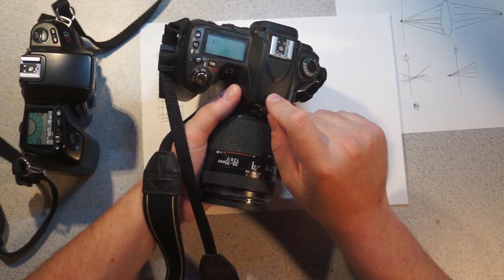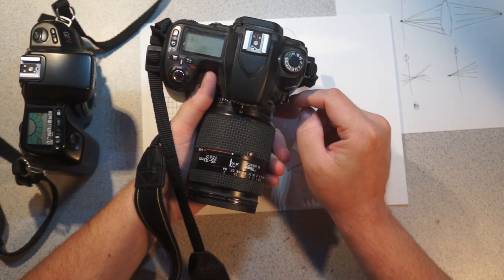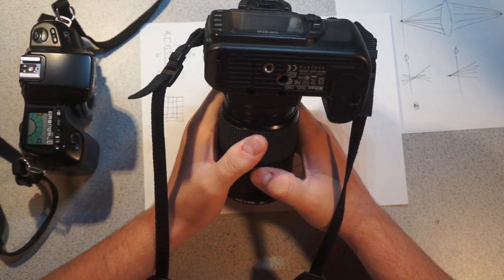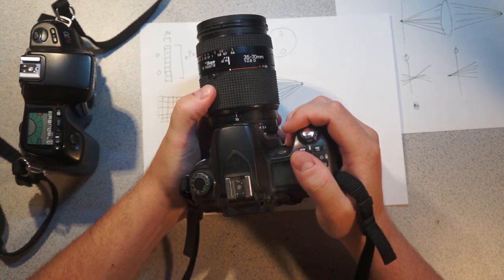I don't have an IR-only pass filter on the meter or on the autofocus sensor, which basically means it meters on a mixture of the two. But theoretically, in a situation where there's only infrared illumination, this camera will still work properly because it has no IR cut filters at all.